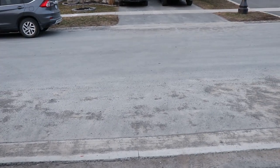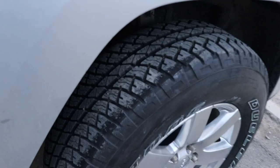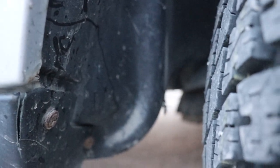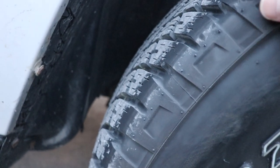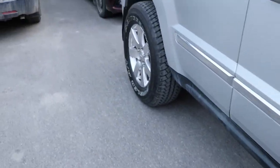Back from the whole trip. When I backed into my driveway and cut the wheel hard, the front wheel caught on the pinch weld. It didn't damage the tire — just left a mark and made a bit of noise — but it did pull some plastic off the cover. I'll have to take both front wheels off and push down the pinch weld a little bit. It's probably only about a half-inch of interference, so I can work with that. These tires are about the limit unless you want to get really aggressive with the pinch weld. Hope you found this useful — thanks for watching.